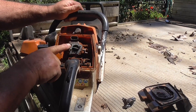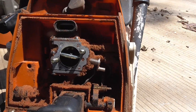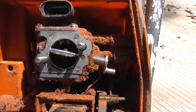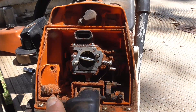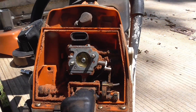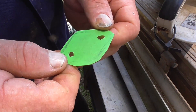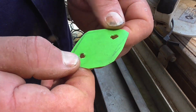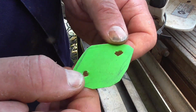The good thing about it is none is actually inside the saw itself where it matters. I need to clean this out in here and I don't want anything to get actually inside the saw. So what I'm going to do is put the choke on and that'll block the butterfly there, and as well as that I'll take a bit of precaution. I've made this little plate out of plastic and I'm going to put that across the mouth of the carburetor and seal it off with a little bit of grease and put the nuts back on and hope that that keeps all the dust out while I blow it out in there.